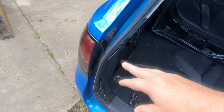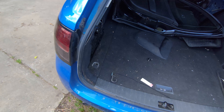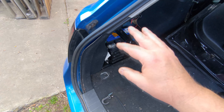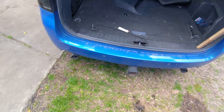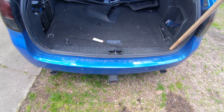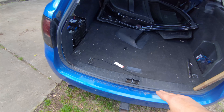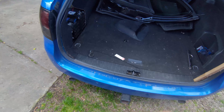If I don't find a problem there, what I'm going to do is just run a wire from that taillight — because that one works — over to this side and get this taillight working, because that's an easy bandaid workaround. But I'll first put a meter on everything and find out what's going on, because apparently old mate got underneath the car and said the cable for the tow bar has been cut. So I have a feeling two wires from the taillight are coming down and joining there, and because they've been cut they're no longer joined — that's why the taillight's not working.